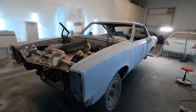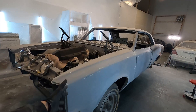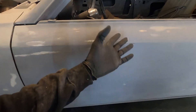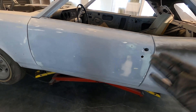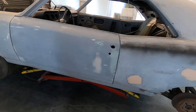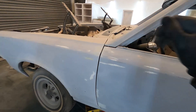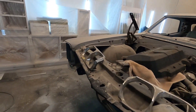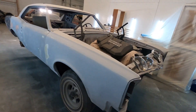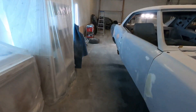So what have I done so far? Fenders and doors on both sides have been block sanded. There are a lot of places where body work had to be done — high spots, low spots all over. Also, when I received all my parts and trims, I went in and got the door jams and fenders aligned on both sides.